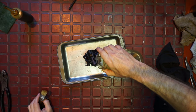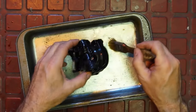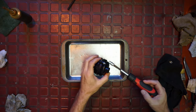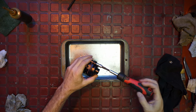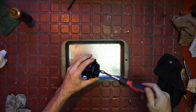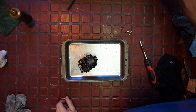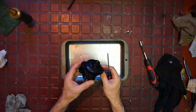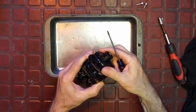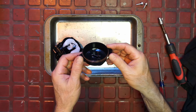I'm going to use a little bit of what we dumped out plus some of this gas that's still sitting — it's clearing up slowly. I'm just going to wipe down the outside so nothing from the outside contaminates the inside. Now this is basically the same size as the other silver ones. This only goes on in one direction, so I'm not concerned when we're taking it apart. I'm going to pull it apart — usually they don't come right off because they're kind of jammed on. I'll grab a little screwdriver and there are a couple of good pry points. Be careful about where you pry. There's junk all around this seam where that O-ring gasket is — I'm going to clean that.